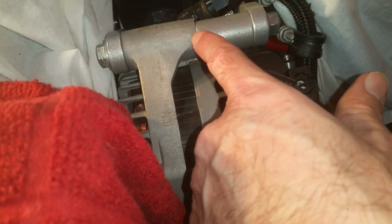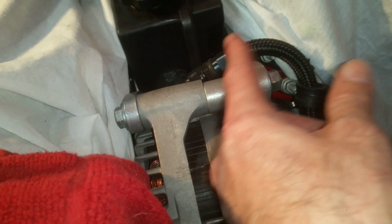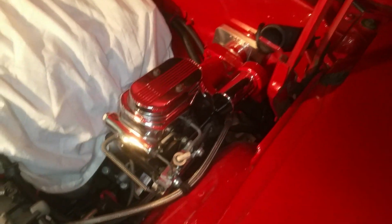And that ensures that no matter what, you don't get any air to go back in the return line. Now, of course, you can see in my setup, I actually have a loop so that air doesn't travel. I mean, air is always gonna go up. So I made this loop on purpose so that if there was air, I don't want it to go back to my HYDROBOOST. So you can see I purposely set it up in this fashion. You don't want air going into your HYDROBOOST setup. So you want the level of the fluid higher than the return line for the HYDROBOOST.